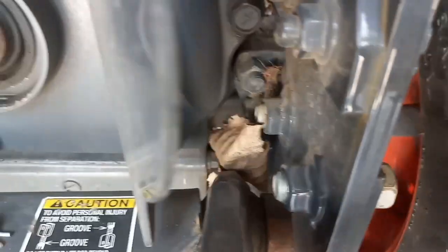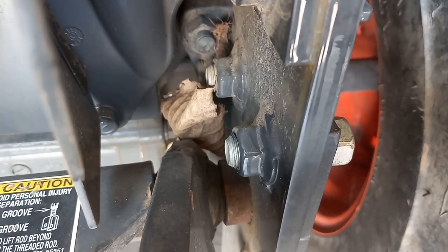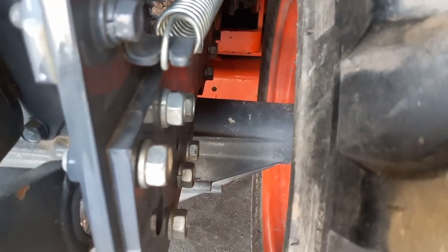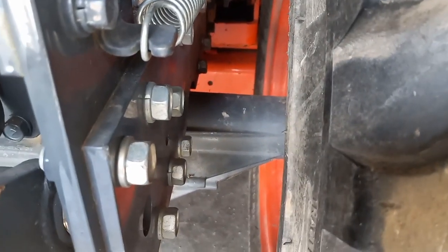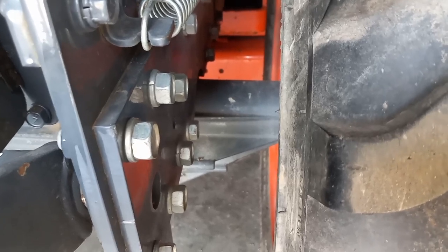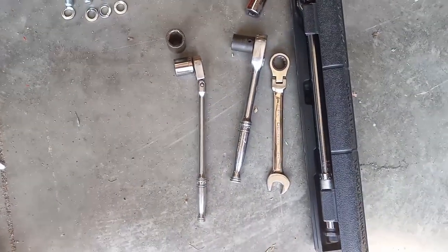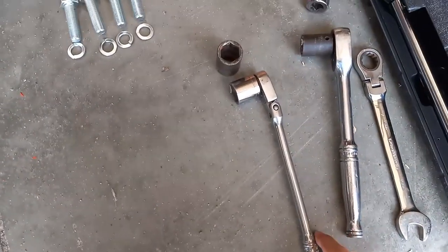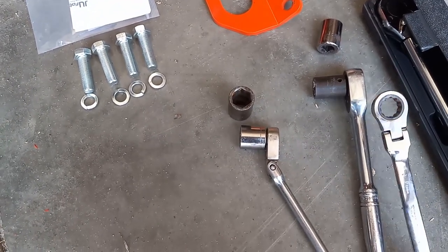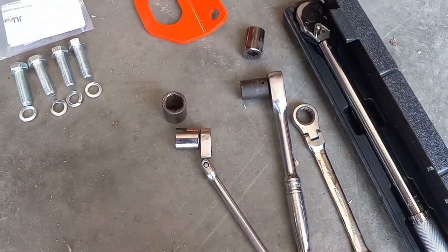If you look at the back side, the nuts are actually welded on, so you don't have to worry about holding them with a wrench while you're backing out the bolts. As you can see, there's not a whole lot of room in between the frame and the rear tires. Depending on what tools you're using, you might want to remove the tires to make it easier — we're just going to be using a ratchet, so it's perfectly fine. These flex head ratchets are going to work out a lot nicer in our situation, along with a ratchet wrench. We also have a torque wrench — we're going to want to torque the bolts to 100 foot-pounds when we're done.